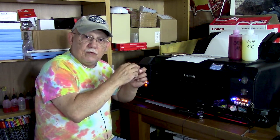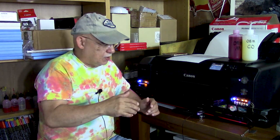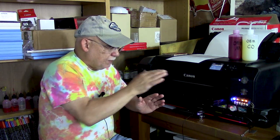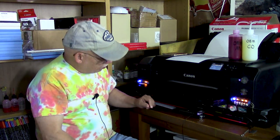Remember, the sensors can be calibrated, as I showed on my live stream. The front cap is removable, and there's the light and a little tiny screw. This is not at all intended to be used the way we are using it — these are not specifically made for sensing ink levels in cartridges. Through experimentation, we found out it will trigger around 10 ml left. For some of you that might be safe enough, but not for me. I adjusted the screw to give me a 20 ml sensitivity, so it's not going to trip until I hit about 20 ml of ink left.